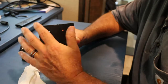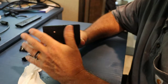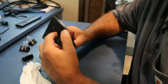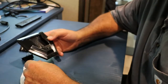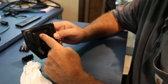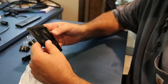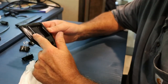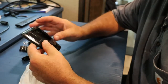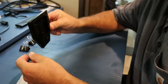But you get a little bit of heat on that tape, on that foam, it just disintegrates, it destroys it, and it'll come apart. And you'll see all the reviews on it, and this is what they talk about. This bracket with that foam tape, it's no good. Change your design. At least make a bracket like this. You can screw the back, put some foam on there and screw it in there. At least you have something to screw through. You don't want to go through these edges with rivets or screws, because eventually it's just going to crack and split. Now this whole base is one piece, silicone, screw it to the side of your rig, and you're good to go.